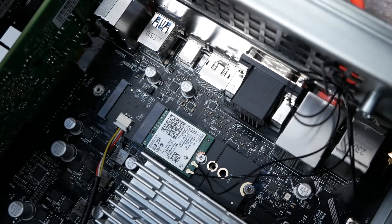What happened when I tried out the M.2 module I bought several months ago: I realized when it wasn't working that the M.2 module I got is not a CNVio module, which is what the motherboard I have supports — CNVio integrates Bluetooth and Wi-Fi on the same module. I found an M.2 adapter that fits in a normal M.2 slot normally used for NVMe. Since my test systems use old SATA SSDs I had an M.2 slot free, and it worked — it was even recognized in Linux — but the performance wasn't great because I don't think it supports the full Wi-Fi 7 feature set in Linux yet. Speeds were roughly on par with Wi-Fi 6.